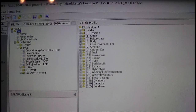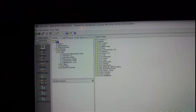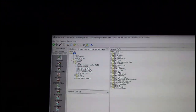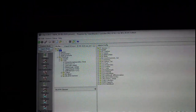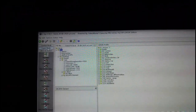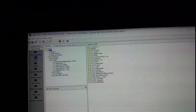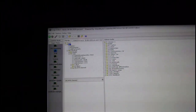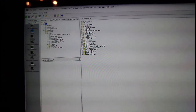Calculate FP - that's calculated correctly because it's given me the vehicle profile. Now we need to save the new FA. Click on Save, go to Expert Mode, then go to VCM, and then we're going to load the FA file that we've just saved and validated.